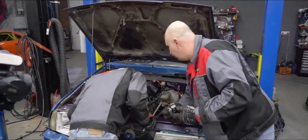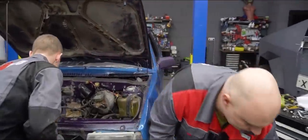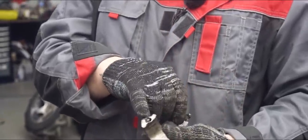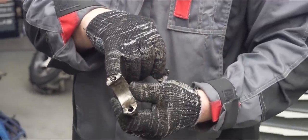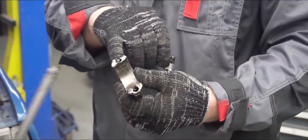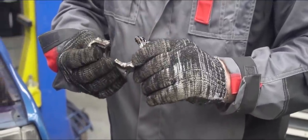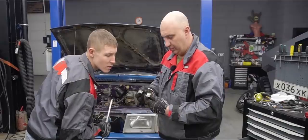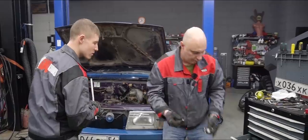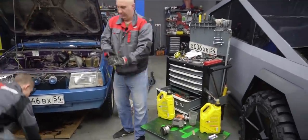Where'd you even find that? They were just right there on top of the crankshaft. So here we've got the rod cap - just look at how badly it was overheated. It's even blue. I gather it took a hit - no, it sustained a few hits. You think it became blue with just one hit? My assumption is that it was under so much stress. Those are from the piston rod that we placed here. So that was piston number four.